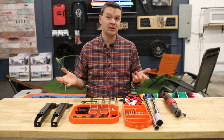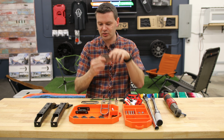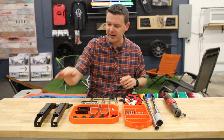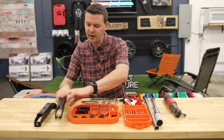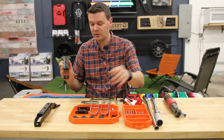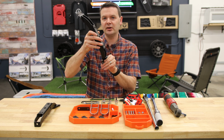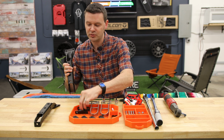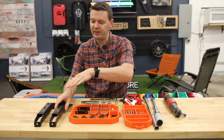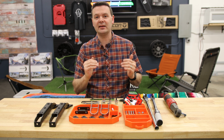What comes in the box when you get the Metalcloak Pro Step? Well, first, of course, you get the hinge step itself. This is where you put your foot. You get the brackets that attach it to your door where your hinges are. And this is actually where Metalcloak improved the design. We'll show it during the install a little bit more, but it's now a two-piece that attaches to your door hinge. And this is a big improvement over the Kargo Master Safari ones, which were a one-piece, because now that they're two-piece, you don't have to unbolt the top and the bottom hinges at the same time.